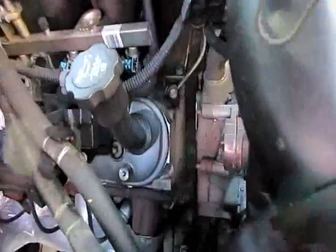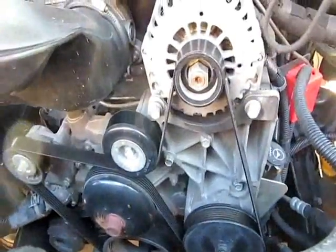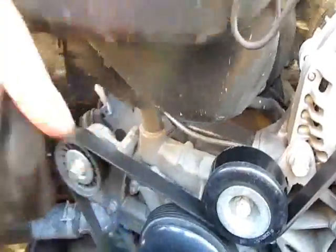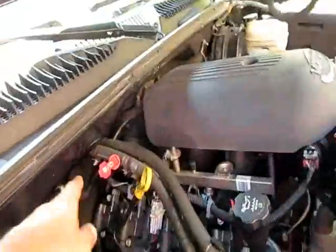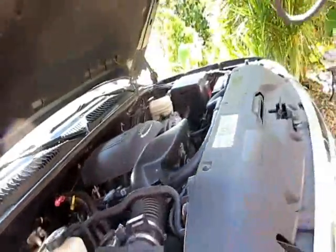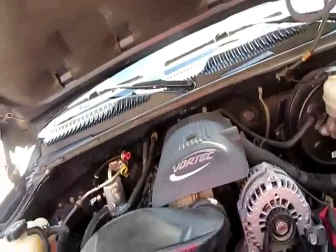These things — if you have 706 heads, they do crack and leak coolant, but I don't think this one has that issue. Water pumps don't have weep holes, so when they start leaking they really don't drip much, but the water pump gaskets do leak. You also get the little crossover pipe that leaks on the corners front and back, and those famous fittings in the back will leak, and that Y over here will leak too. Of course your radiator could leak as well. But if you're losing just a little coolant on a 99 to 2013 or 14 — same engine — check that cap out.